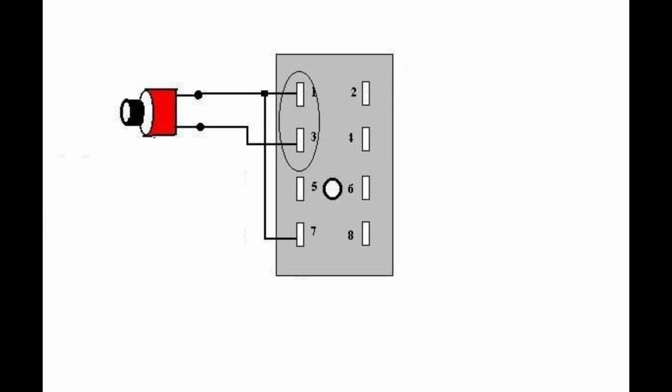If you choose to remove the coin mechanism, you need to connect point 7 with point 1. However, I decided to keep the coin mechanism in place. In my setup, I connected COM and NO to points 1 and 3. Be aware that your Johnson connection might be mirrored depending on how the wiring is set up inside your machine. You'll figure this out by checking which wire comes out of the Johnson connection.